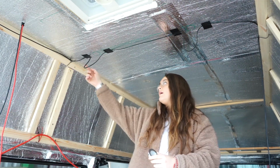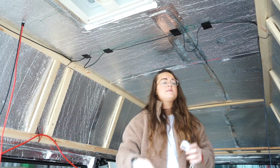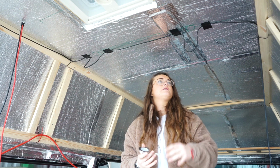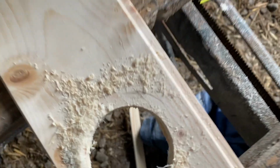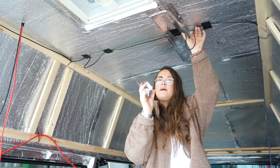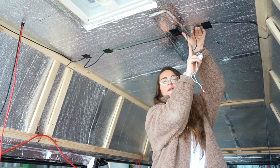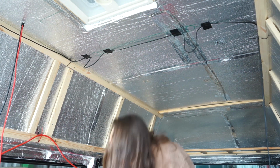The reason why I've come across and then done a loop, if you're new to electrics, is a trick that I learned from YouTube. When it does come to putting the cladding up, we will create holes in the cladding so that can go through there. And then when it comes to actually wiring the lights, cut that there. That will then expose two sets of these. And when it comes to actually wiring, that's when I'll show you what to do.